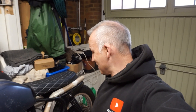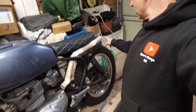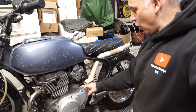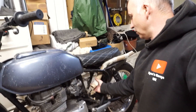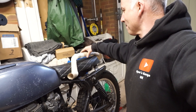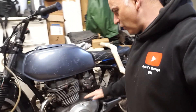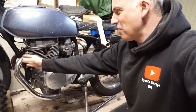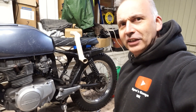There we are — cardboard-aided design. There is a potential route for my exhaust: running down the side of the top frame, inside this leg, then around and across the top of the case to join up at the front. That's potentially the shape I'd need to create for the back end, which isn't massively complicated. It then needs to run across the top of the case, relatively high off the ground for clearance, with a relatively tight curve at the front — but that's no tighter than they run on the Honda XL, so I think it's possible.